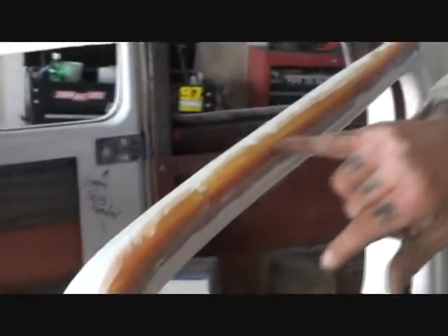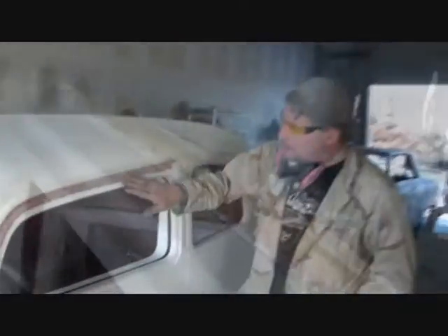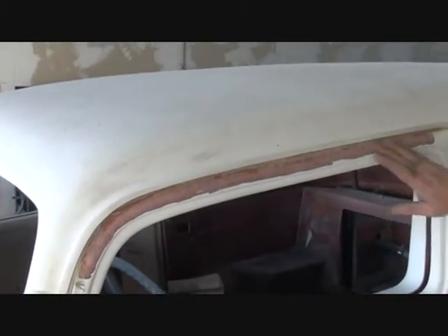If Jeff can hold the camera there, give us a nice clean grip on that — don't drop it. What Jeff did is actually looking really good. If you notice, you can see the light through — that's how much we had to build that door up. Jeff also grinded this down to raw fiberglass right here. We went ahead and blocked it in, made ourselves a homemade jig, filled it in with fiberglass just like we showed you. Now we're going to sand all that down. Jeff has nicely molded that for us with the grinder.